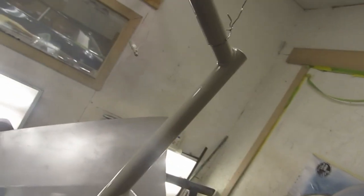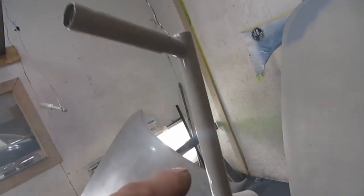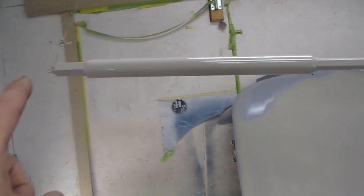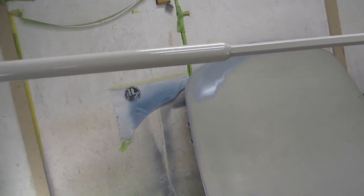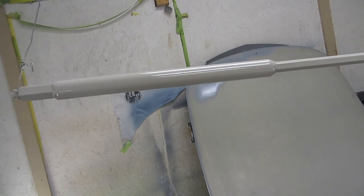This is the starting crank handle that all DS have. It is stowed with the jack in the spare tire, and this is in that area somewhere. This is the actual crank that fits through a hole in the front of the car. Handle goes on there. That fits into the front of the transmission and will allow you to crank start the car if the battery's dead, because you could not push start these cars because they sat on the ground when they leaked out.